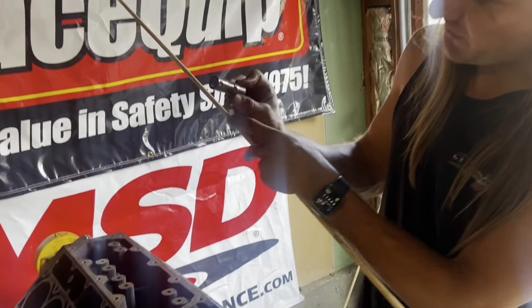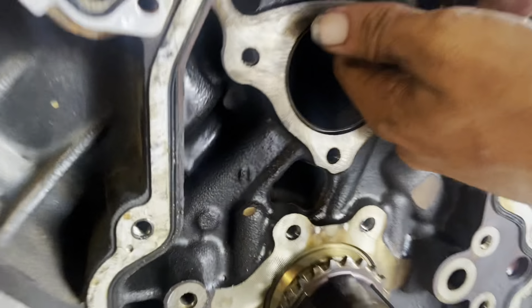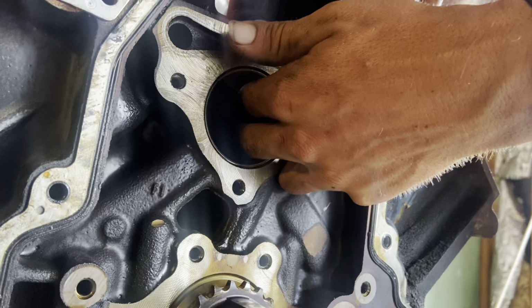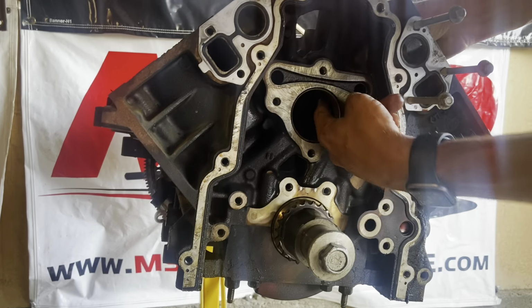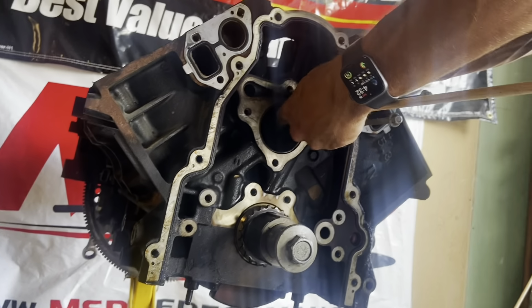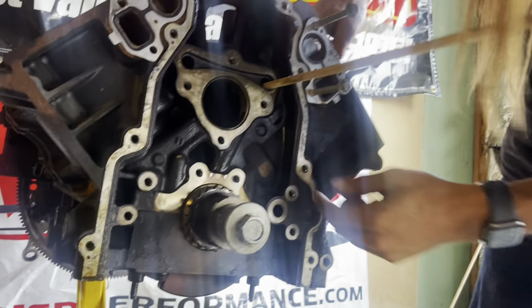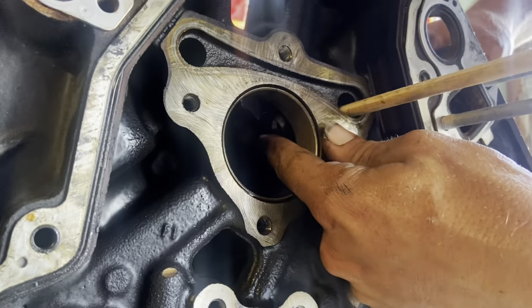So as you can see on the stock lifter, there's a little pocket here. So put the lifter in, shine it in here. As you can see, with no cam inside, the lifter can just fall straight through and ruin your cam swap. But when it's in its spot and rolling, and then the dowel pin can slide, yeah, just like that. And then now I can push on the lifter. You can see it. Can you see it in there? Yep. Yeah, it cannot drop any further down.